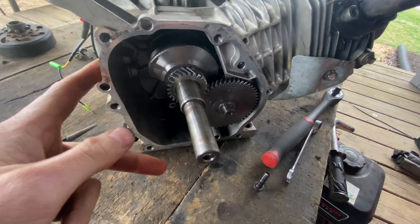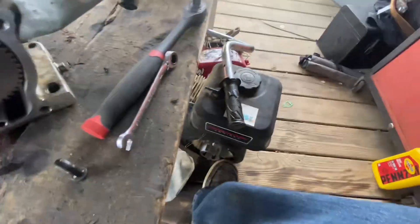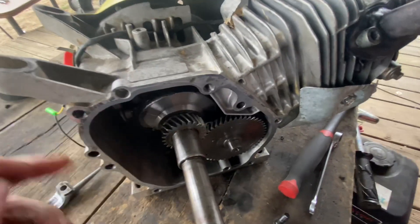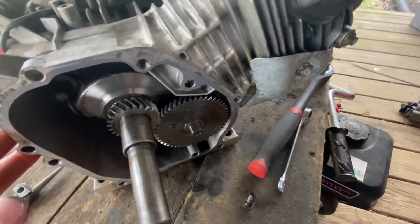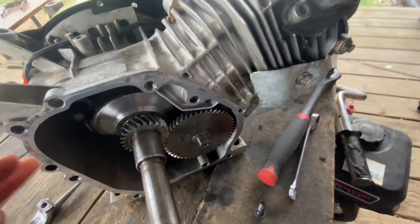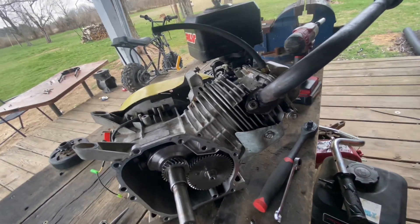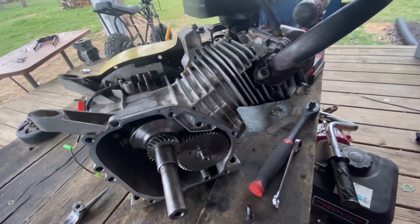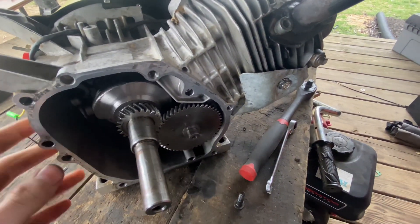As of now this motor's done — that's the second motor I've blown up in less than a month. The other one is right down there, off the chopper. I could rebuild that one; all it needs is a set of rings, which is only a couple dollars. I also need to get throttle rods in the spring and put this carburetor on that one with the air box, because riding in wet conditions the air filter adjustment just wasn't working right.